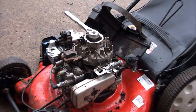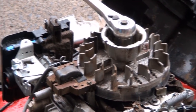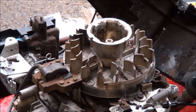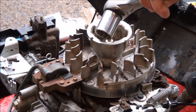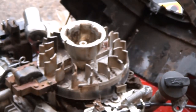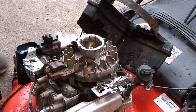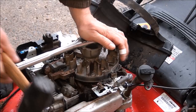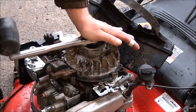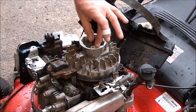There's a nut down in there — that's how you take it off. It's not an American size; it's a 24 millimeter. If you don't have an impact socket to zip that thing off, I'll show you how I used to do it back in the old days. Just put it on here and give it a sharp tap — not so hard that you break something, but a good whack. See, now we're loose. Good tip, huh?